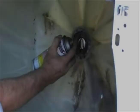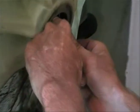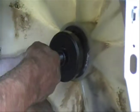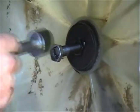Pull it out of there. Now we're going to put our tool up on this side and go around with the plate on the backside. The plate goes on step-down first, throw an extra washer on there, and the left-hand thread goes backwards — just hand tight. Same kind of process for the front: take up the slack, get it centered up in that bearing, and run it down until you're squared up. Then go counter-clockwise on this one.